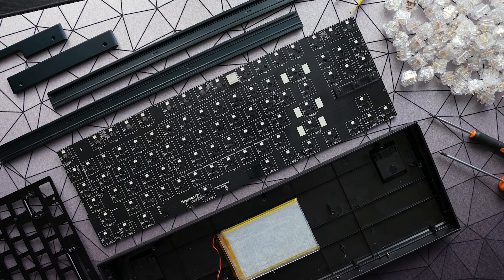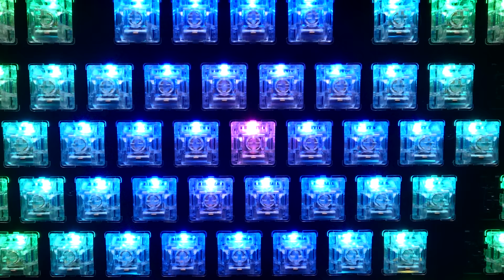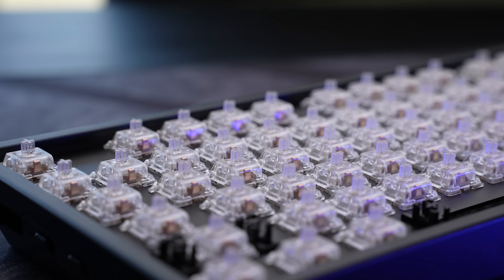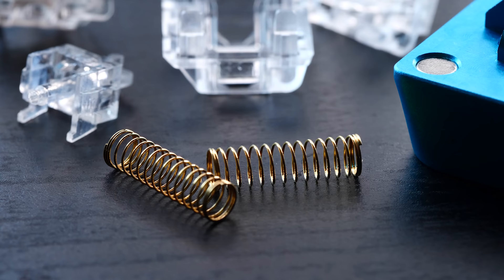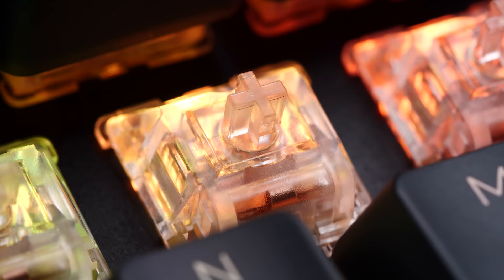The flexible nature of this board does allow for modding, so let's do exactly that. First up: some new switches — these are the Everglide AquaKing V3 linears. These are really heavily lubed from the factory and in my opinion the stock linear to look for if you don't want to go through the trouble of lubing your own switches. They feel a little sluggish or over-lubed at first, but break them in for a while and they're great. Pretty top-tier sound right out of the box — no ping, no spring crunch. They're higher pitched than Ink Blacks or H1s, not as high pitched as a Tangie. I went with the lighter spring weight here, and I really, really like these.